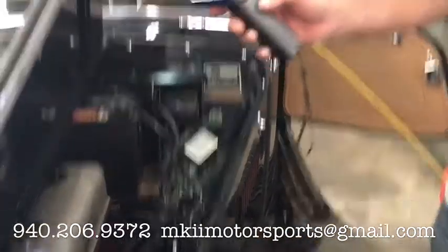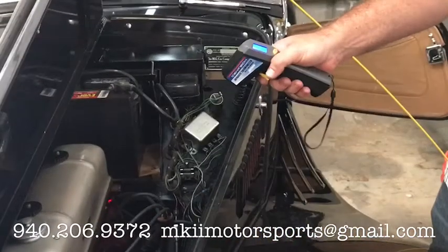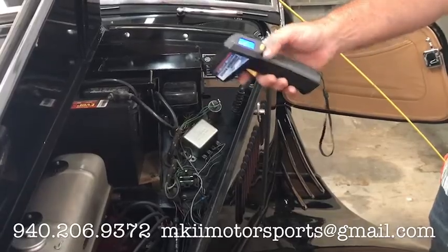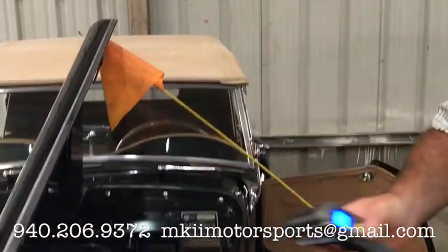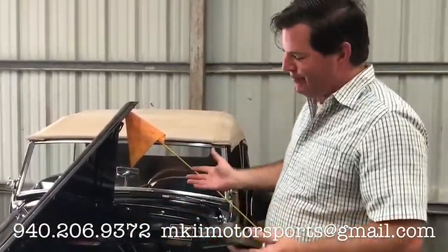Spark plug number one: 147. Spark plug number two: 147. Spark plug number three: 148. Spark plug number four: 151. You get that heat differentiation because the exhaust pipe is moving backwards on the car, going from the front cylinder to the back. It's sitting here idling, so it's warming up the back cylinder faster. Regardless, very consistent numbers on the car.